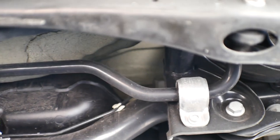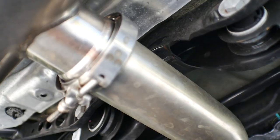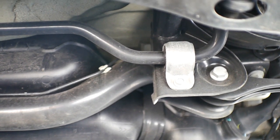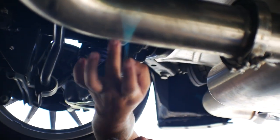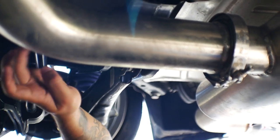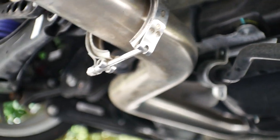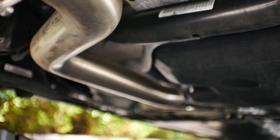The end links are going to be right here - you're going to remove this bolt and a top bolt that's over there as well, and then on the inside up here you see this little bracket that needs to come off, same thing on the other side. You'll need some special tools for this - I'll put a link in the description for the bits I have. From the looks of it I am going to have to take off this exhaust bracket over here so that the pipe can slide down and I can remove this. After you remove all six bolts this thing just kind of dangles, so you need to move this out of the way. After you remove this clamp it's very easy to slide this out - just work it around, twist it, and bring it out.